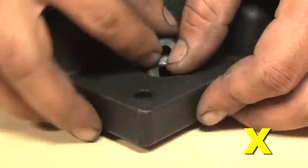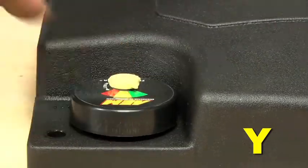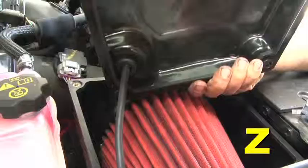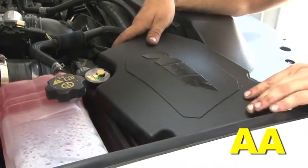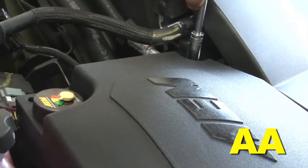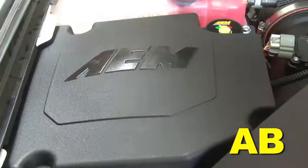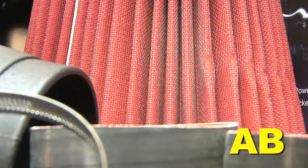You are now ready to seal the air box. Install the grommet onto the 0.75 inch hole in the corner of the air box lid. Install the filter minder gauge into the large grommet, using glass cleaner to lubricate the hole in the grommet if needed. Guide the loose end of the 5/32 inch air hose already attached to the filter cap onto the small port of the filter minder gauge through the air box lid. Install the air box lid onto the air box using the M6 hex flange bolts provided — start all four bolts by hand first, then tighten them with a 10 mm socket to seal the air box. Make sure the AEM filter minder gauge needle is pointing to the green sector. Once your dry flow filter is dirty and the pressure drop restriction across it reaches 20 inches of H2O, the gauge needle will point to the red sector, meaning it is time to wash your reusable AEM dry flow air filter.